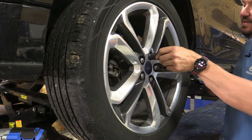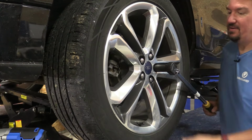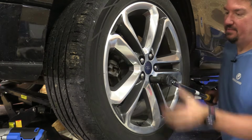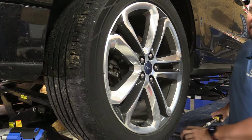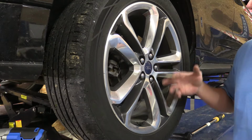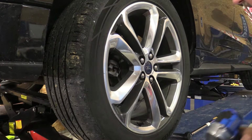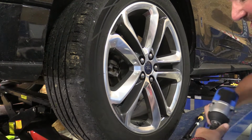I was able to put a little on that one. That one was already there. That one was there. I already did that one. So hand tight level 3, not something you're gonna do on lugs unless maybe you were doing a larger 3/4 ton or higher truck. Looks like it's gonna get us to right around 110, 100 foot-pounds, right in that area.